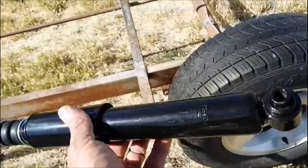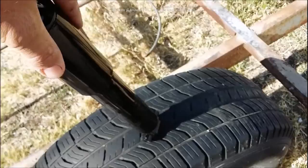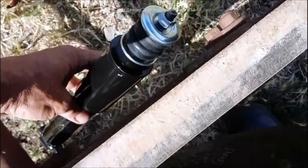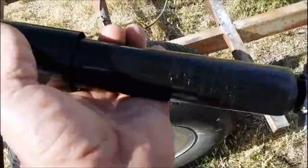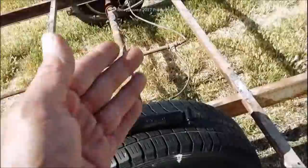For about ten to twenty dollars a piece, when you're talking about a hundred dollars worth of good quality eight- or ten-ply trailer tires, you can get something like these Gabriels — model 7-4961-4. They compress down to about eight and a half inches, making them pretty short. They've got about three and a quarter to three and a half inches of travel, and that allows me to place them right in the frame so they fit without hitting anything when fully extended.